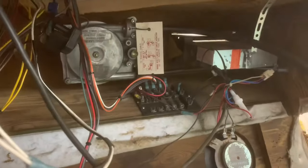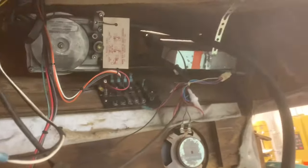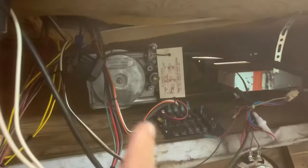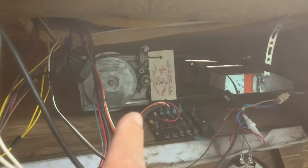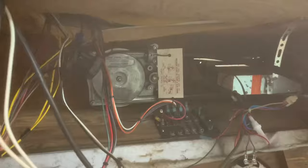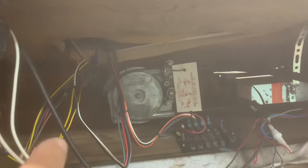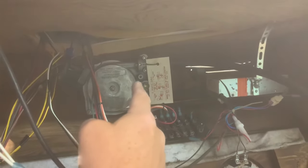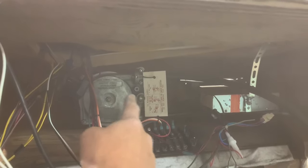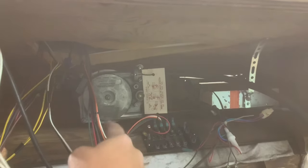This boat does not have hydraulic steering — it has cable drive steering. You can see the tag on there with a pin through it. That pin has to be pulled out, then you turn the steering wheel. You would think you'd turn left, but you actually have to turn right to get the cable to back out. I'm going to pull that pin and use it to push in to release the steering cable as I spin the steering wheel.